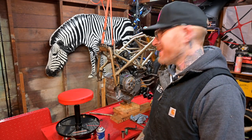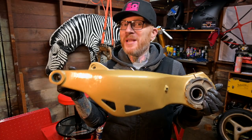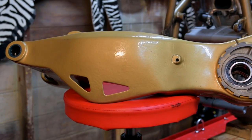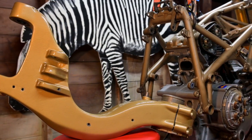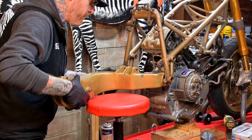We're almost done for the day and you'll notice we are missing a fairly large piece of the puzzle to make this thing a roller, and that leads me to what I'm going to show you next. This may be the crown jewel of this build — it was non-negotiable, and they're almost impossible to find unless you know where to look. So thank you Michael from Championship Cycles for coming through with this, because this is a competition-length Bursig magnesium swing arm. I looked forever for one of these — this is a big deal. One of the big reasons for getting one is they are quite a bit lighter and quite a bit longer than the stock swing arm. I remember reading an interview with Pierre Terblanche, the guy that designed the 999, saying that they put a longer swing arm in the factory 916 and it made it handle a heck of a lot better — it never quite made it to the street versions, but all the competition versions had them. So we do too.